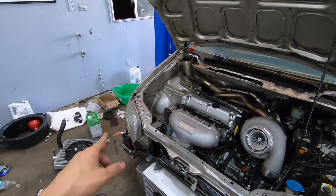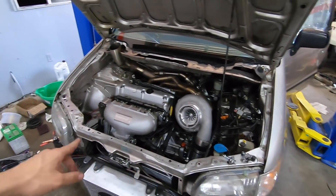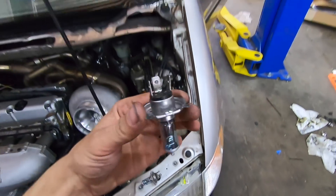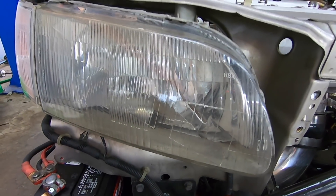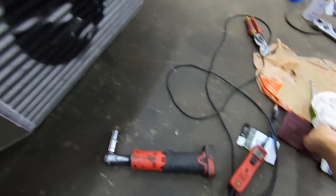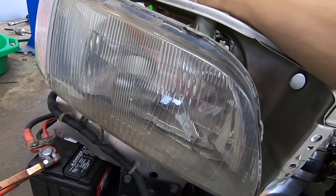Now they both come back on. That side was a little dim — turns out the plug is also pretty loose. They have these little prongs on the bottom and I bent the prong out just a little bit so it actually hugs in there a lot tighter, and then it brightened right up. Those are good to go. Before I can put them in I need to fish out an old headlight that's been dangling in the housing since we first got the Radicee. I was in the middle of unbolting the headlight to try to dump it out through the hole in the back, but I just realized I could probably just get a magnet and fish it out. This headlight has never worked since we got the Radicee.